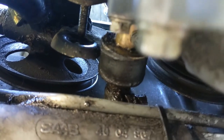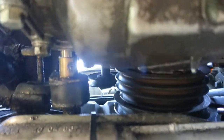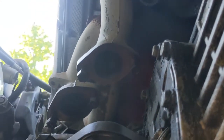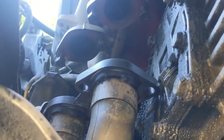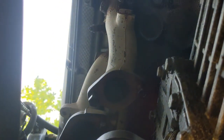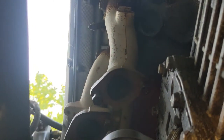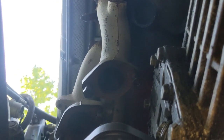The shift coupler is now not attached to the shifter in the car — easily done with that pinch bolt, so I don't have to worry about that taper pin. And I've also unbolted the exhaust manifold down here — all four studs remained in the manifold. I put the nuts back on, but the collector/downpipe is now out of the way. At this point I am done underneath the car, with the sole exception of pulling the CVs out. I'll do that absolutely last so I don't have to worry about grease going everywhere.